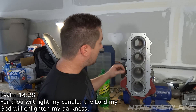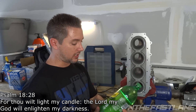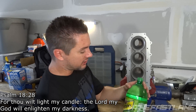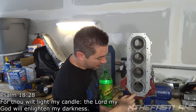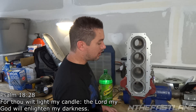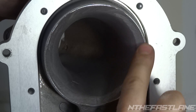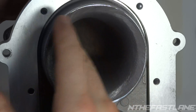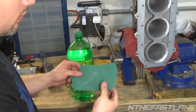We're going to take a regular two-liter soda bottle — you can get them at any grocery store for like 68 cents — wrap some sandpaper around it, glue it on, and it has a nice velocity shape. We'll put it in these ports to shape the runners. From the factory, they just take a die grinder and grind them out — poor quality control. You can see it's out of round: look how thick it is here and then really thin here, so you're not getting a true velocity. Inside the runners they leave big chunks of casting that should all be polished out from the factory.